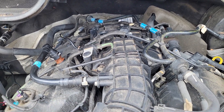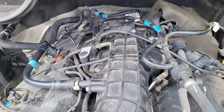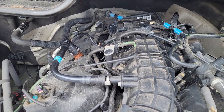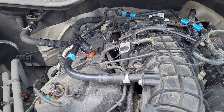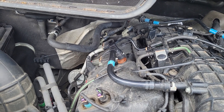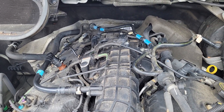I was looking for alternate means and searched online high and low but didn't find much information. I did read that somebody suggested removing the whole intake manifold, which would probably give you a lot easier access from the top — but these are plastic manifolds, and I've heard from quite a few people that they break easily. I don't want to put a lot of extra money into this, so I looked from the bottom and found there is a possible access route around the exhaust, reaching up from the bottom over the top of the transmission. That is feasible, although it is difficult.